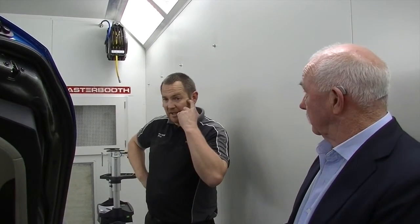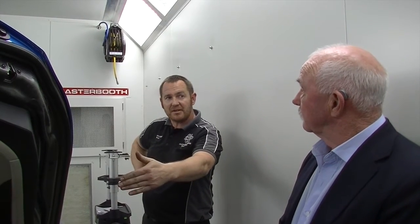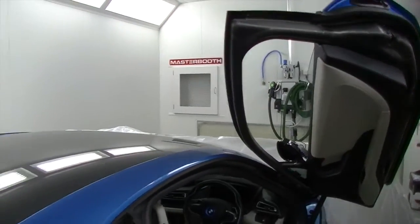And the rear is secured by just bolts. As far as we know, if it gets hit in the rear and the beam panel gets damaged, the roof has to come off. You have to peel the roof off and then work your way to the back of the car again.